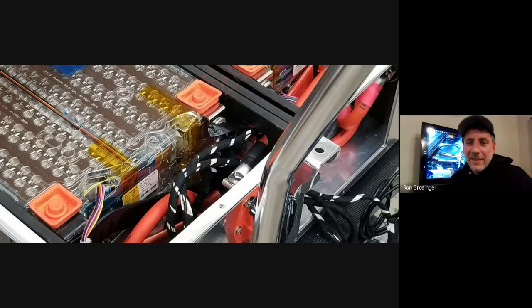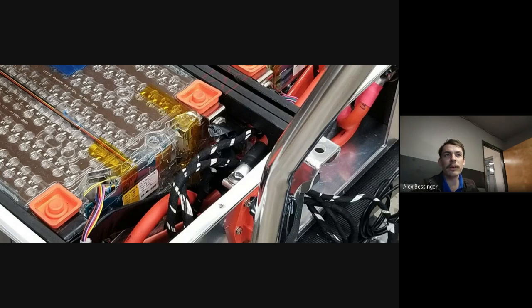Oh, really? That could be a part of it, but if it were a healthy battery to start with, it shouldn't have been a problem in the first place. It probably had maybe a cell or a group of cells from a bad batch that just took some amount of time to come up as an issue. And usually it's relatively low mileage where that thing pops up. What kind of mileage was your first pack replaced at?